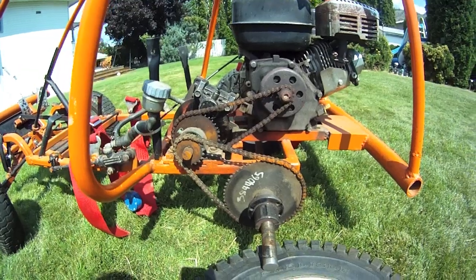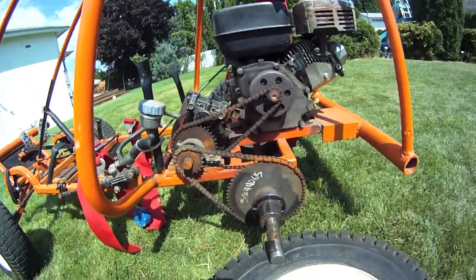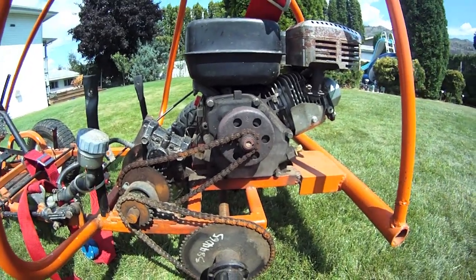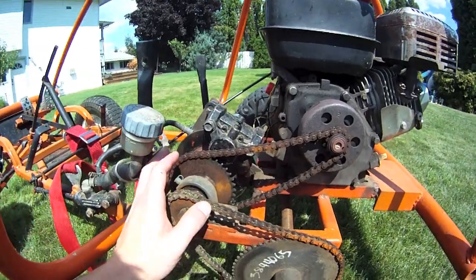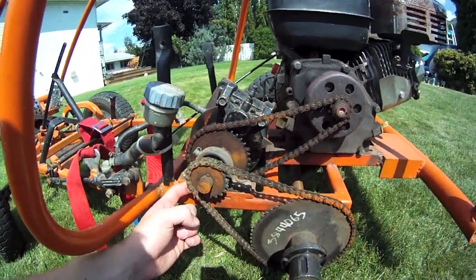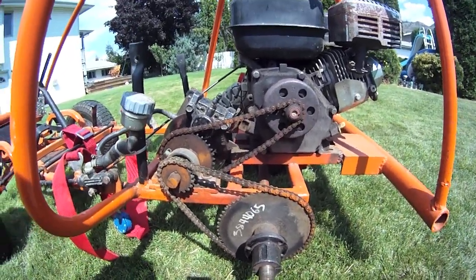The second most commonly asked question is how big are my sprocket sizes and what my gear ratio is. So we have the beautiful side of the engine here. There's my centrifugal clutch — $50 at Princess Auto. It goes from the 32-tooth sprocket to the 20-tooth sprocket, and then to the 60-tooth sprocket, for a ratio of about 8 or 9 to 1.